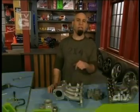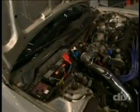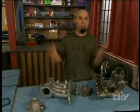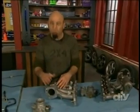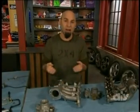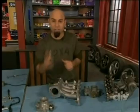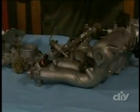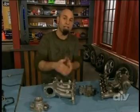Welcome back to Tricked Out, where I turn ordinary sport compact cars into superior rides. Today I've been tricking out a 1999 Acura Integra with some high-flow air and fuel system upgrades to wake up the engine and grab more horsepower across the power band. I've already ripped out the old intake manifold, and this gives me a good chance to show you the difference between the two. The main difference is the design — look at the new one's big, huge plenum, that air chamber. At higher RPMs the engine demands more air, and with this big plenum we're going to have reserve air so the engine's never gasping. Also, the straight runners versus the old curved ones mean air gets to the combustion chamber faster for a quicker response at the top end.